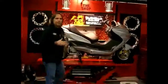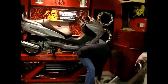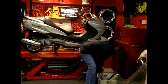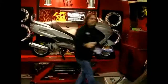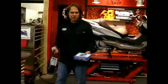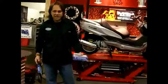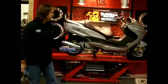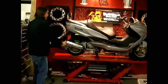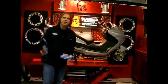Tommy Thunder's going to get you an exhaust on this today. It's also going to upgrade the transmission. All the way with Tuanini — Tuanini high-performance clutch, 10-gram roller weights, 10.1 to be exact. Tuanini Kevlar belt — no slip in the trans. Plenty of air coming out the chrome exhaust. We'll also do the air filter and take a look at the jet and the carburetor.